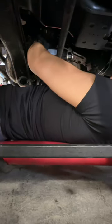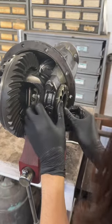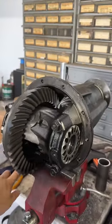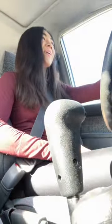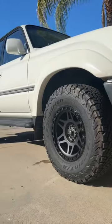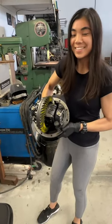But bring in 4.56 gears, and now with the big tires, I end up getting closer to the stock effective gearing ratio, allowing for smoother power delivery and not to mention reduced strain on the engine. The acceleration wasn't a lot to begin with, but it definitely feels a lot better now, even though I've got bigger and heavier tires. Overall, I'm happy with how it turned out, so I think this re-gear was worth it for my build.